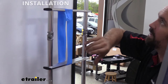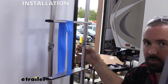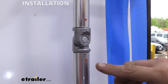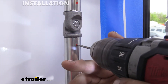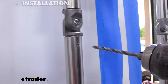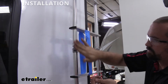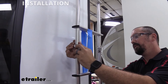With the top and bottom brackets mounted up, it's all starting to come together. These hinges are just coupling pieces, so we're going to drill through them and run hardware through. Drill the holes large enough to fit your machine screw through — I'll mark off about half an inch, which should put us at a good point. Run a small pilot hole first, then go back with the larger bit to allow the hardware through. Follow that same hole through both sides. When installing the screw, make sure the screw head is facing out so there's less for your feet to catch on as you go up. Finger-tighten the nut down.